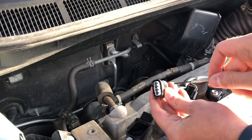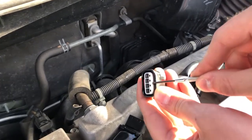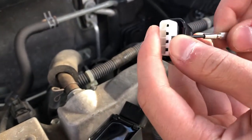To replace the ignition coil connector, you take a small flathead screwdriver, get in behind the black plastic and go in where there's a dip in the white plastic. You pop this up just like this, and this comes off.